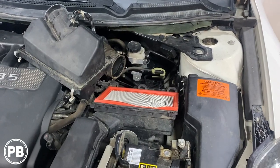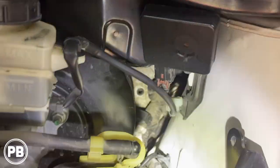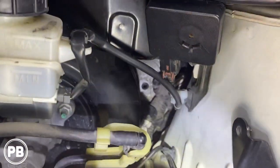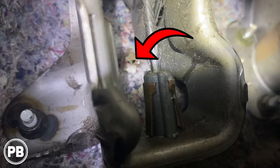And we're going to show you exactly where that went through. So grabbing our light here, you can kind of see that hole right there. 1/2-inch hole. And we already went ahead and put our grommet in there. It's a little 1/2-inch grommet. It'll fit in that location. Up underneath the steering column here, it comes out right there. So there's that little hole, but there's plenty of space there. So we went right through there, and now we're going to feed our wire through.